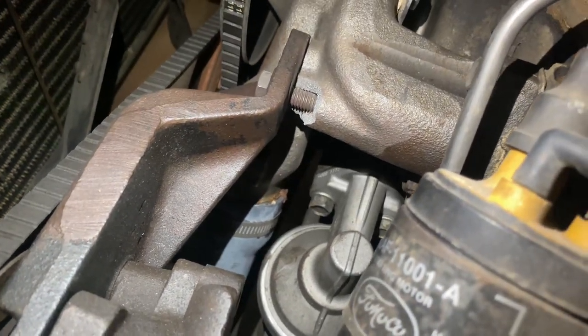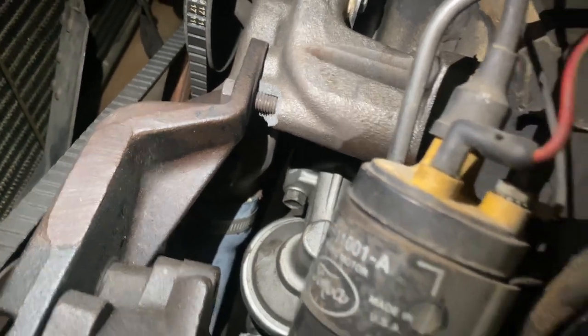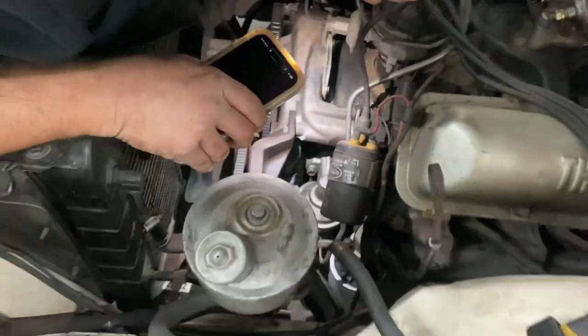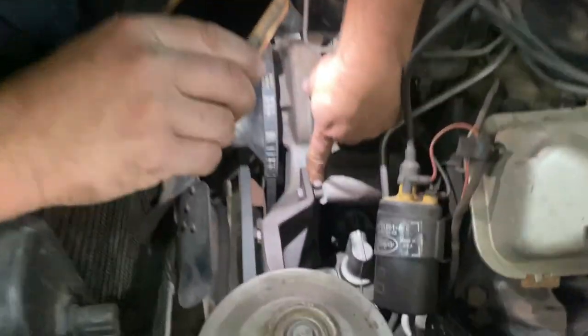And ladies and gentlemen, even if you crank down that hose clamp it's still gonna leak, because it's penetrated to the inside of the hose and coming up through the threads. So we got a leak there, and this water pump has a broken tab too.